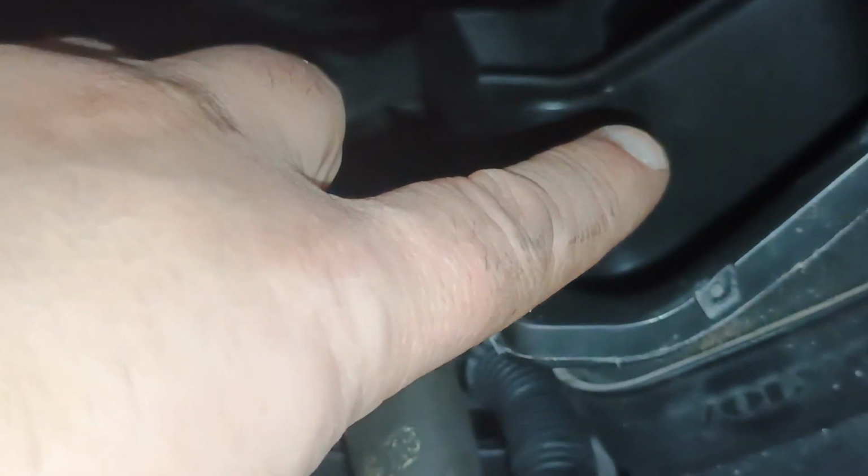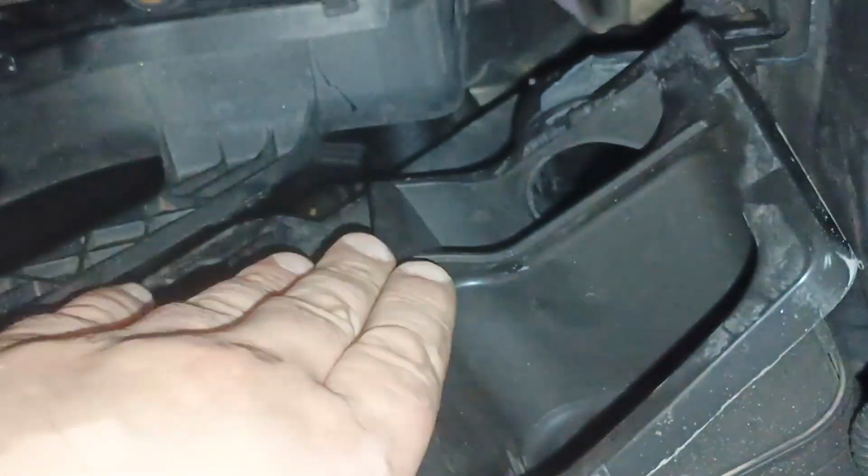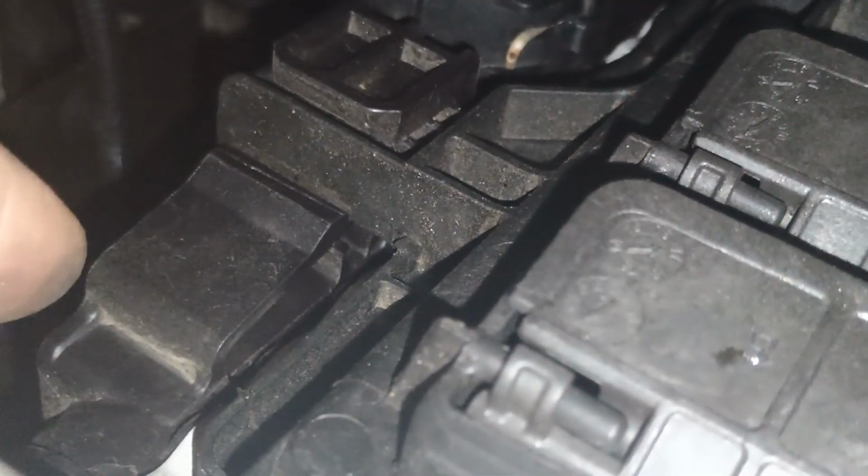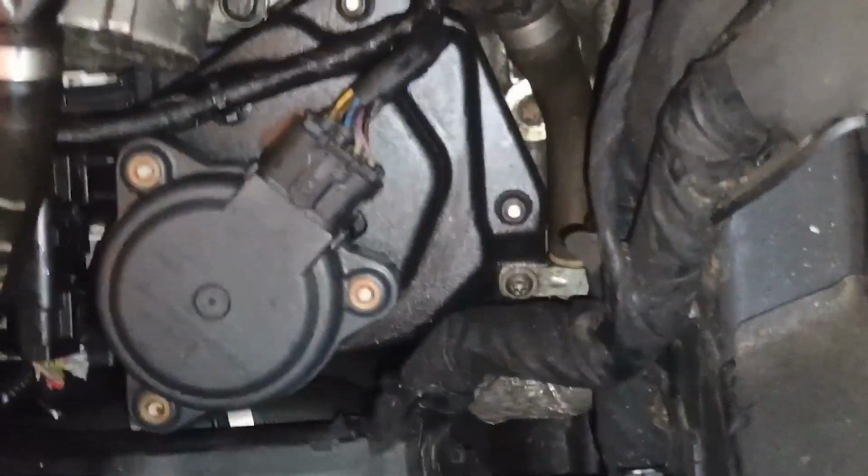Now we can do it without removing the fan, the coolant fan. This one, the big guy. So we have to remove this bolt, undo these wires. Maybe remove that, maybe not. Highly likely yes, rather than not, because that covers the clips. The radiator has 4 clips. They all look like, where is it? Yeah, this one. See that one? That is a clip, so you have to press it down and pull it out. Pull it on top. Right? Okay.